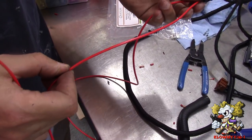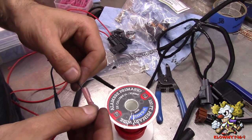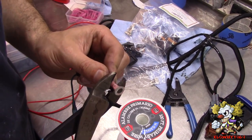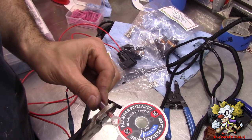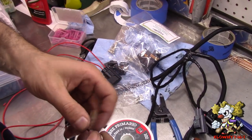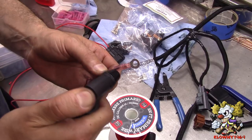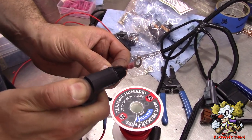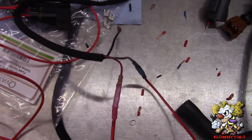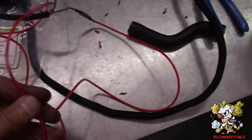We're going to put an eyelet on the power wire and connect that to the power distribution block next to the battery. The ground black wire feeds the ground to the relay and the pump - we're going to put an eyelet on it and this is going to go onto the bolt that went into the body of the car that mounted the bracket of the pump. I also did the red wire, the 12 volt switched wire to the relay, and we're going to put that to a 12 volt switch source.